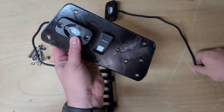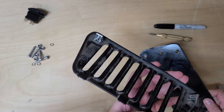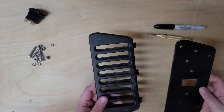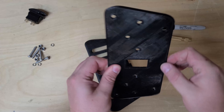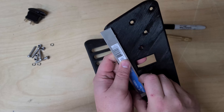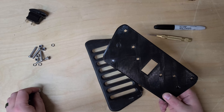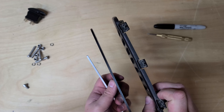The way this connects to the Jeep, it's got a couple of little push connect fittings — little pop-in connectors — and then this side actually tucks under the sheet metal. I got this idea from a design I saw online. They just have two screws holding it in, but I tried that and it's a little too flexible for my liking. So I'm going to go ahead and put this little piece of aluminum here with some threaded M6 holes in it, so I can run some screws through and it'll sandwich the other side of the sheet metal in the Jeep — kind of like those clips would — and make it a lot more secure.